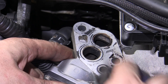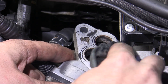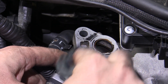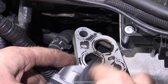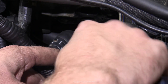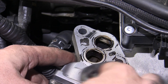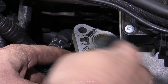I didn't want to have to replace the entire coolant hose — it's a weird Ford proprietary thing that's probably going to be expensive. In my case the valve was fine and I didn't need to remove it fully. At this point you can get a look inside the valve and do some basic cleaning. Ideally you'd take it away and soak the whole body portion in carb cleaner, maybe overnight.